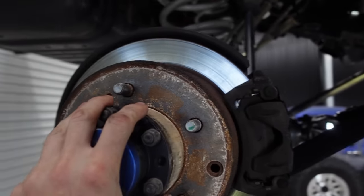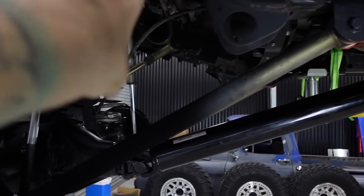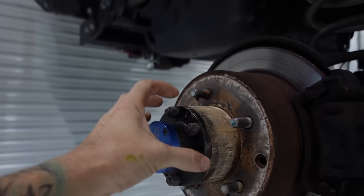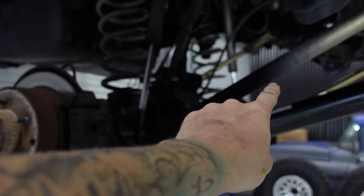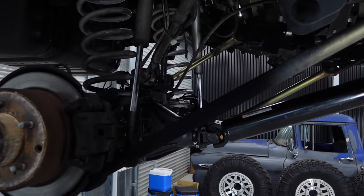It's a little bit rusty and a little bit sooty - I need to angle that exhaust pipe a different way. We're basically going to undo these six axle bolts, pull it out six inches, do the other side as well, disconnect the tailshaft, and we should be able to pull that whole center out.